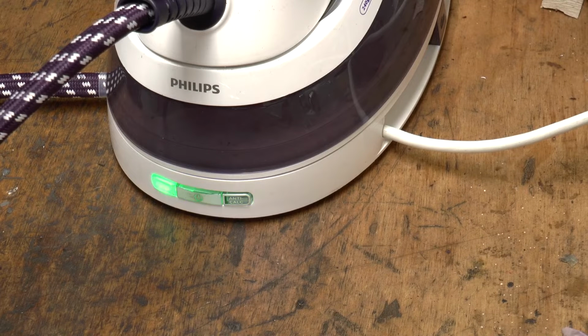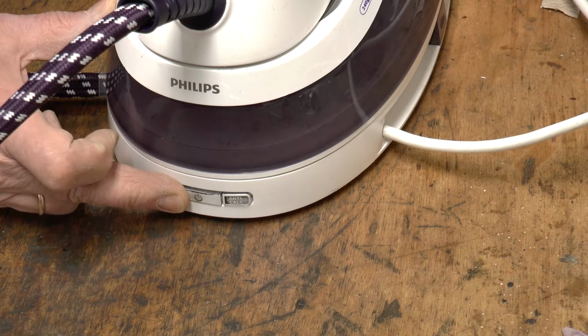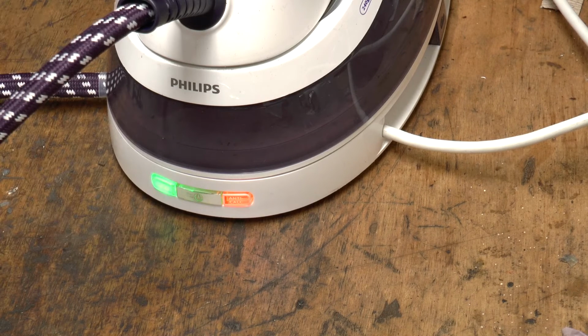Sometimes, if the fault occurs, it is not even possible to reset the machine, and I will demonstrate this. So I undo the wall outlet. I do the reset process by pressing both buttons simultaneously and reinsert the wall plug. And we will see that the machine faults immediately and will not start up.